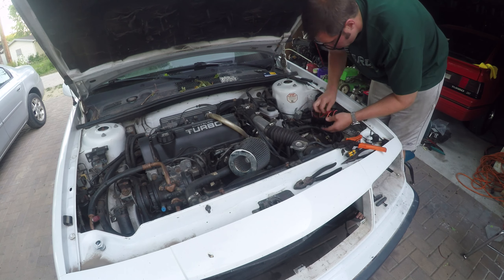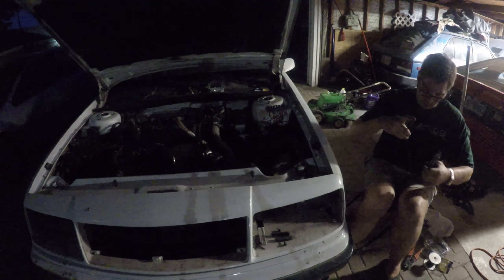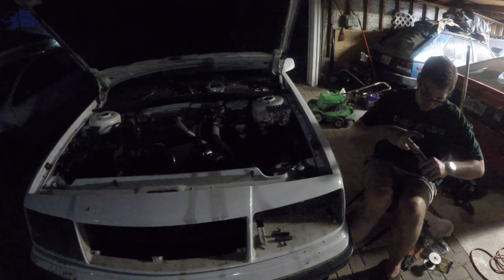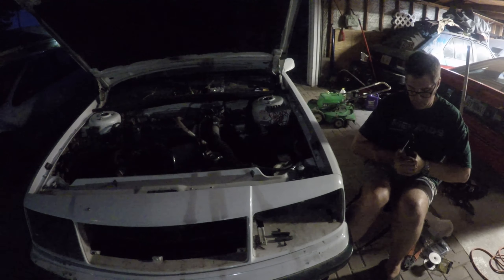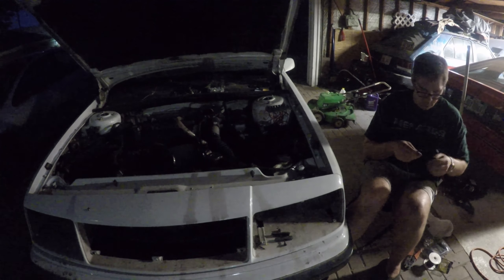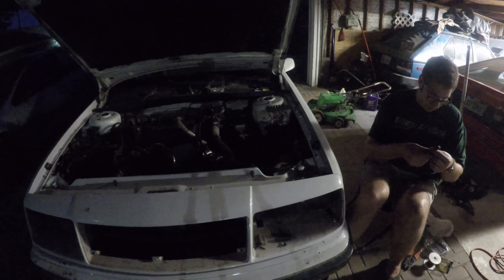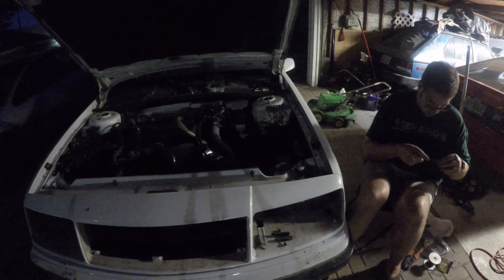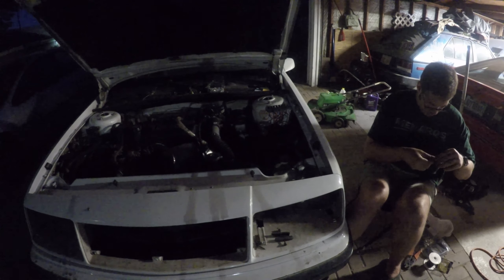I could get by with three of them in addition to the other two, so I could easily cut out that one relay for the driving lights. But I really like having the dual 87 terminal relays, and I like running those separate wires and then a separate ground on each side of the car. That way, if you hit a deer or anything like that, you've got options. You can nurse it home if you're in the middle of nowhere — reconfigure things, pop out a terminal, put it in somewhere else. If a relay fails, et cetera, it gives you options.